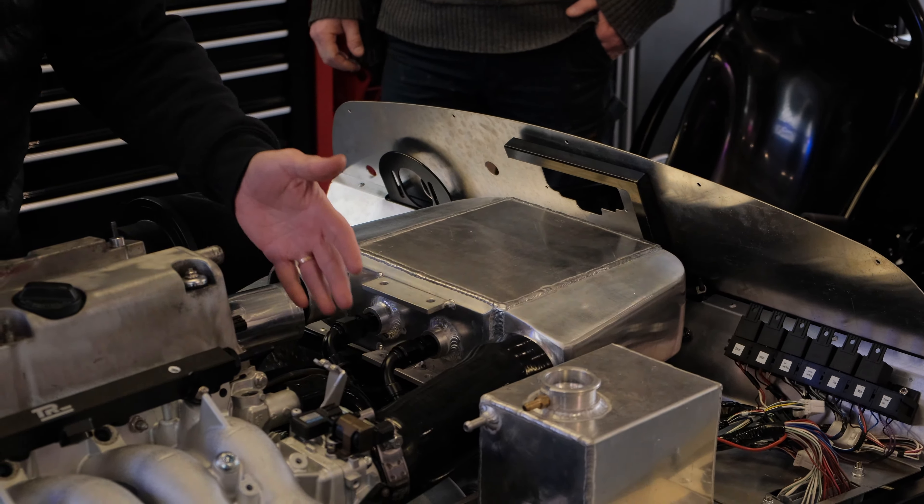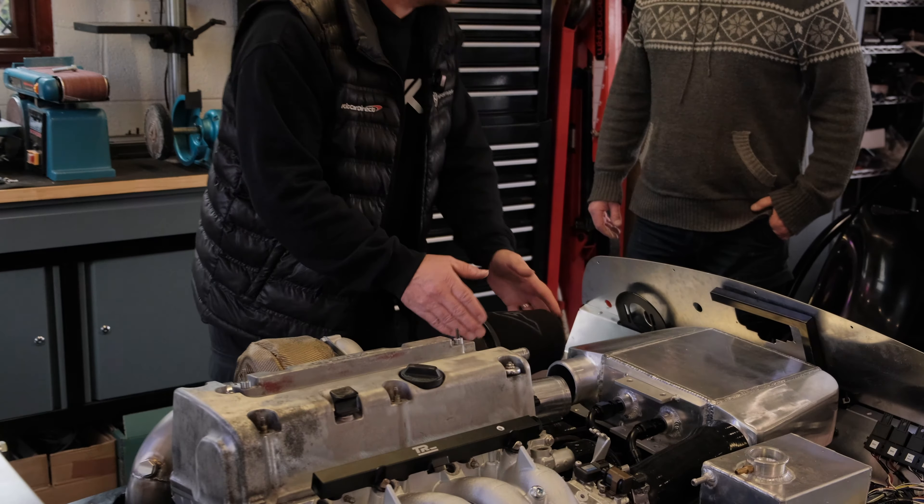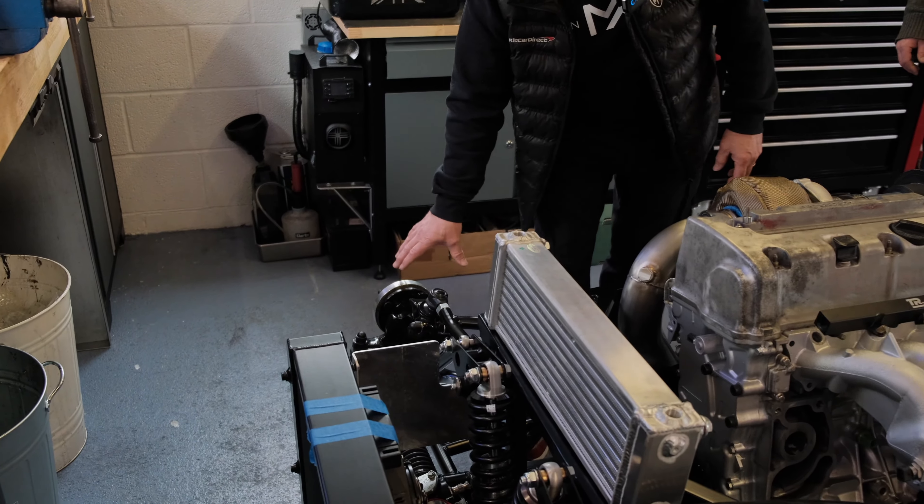Ben has been beavering away here and a lot's gone on. This is a Honda K20 engine, A2, mated to a BMW 330D gearbox, adapter plate, clutch, etc. - all on there. Pulsar turbo, I think it's a 3076 or something, big enough to do 400 horsepower. The link pipe was all done, all the exhaust system - really, really nice shape done. It's got a 38mm wastegate tucked under here, so we didn't do a screamer pipe - we built that in to keep the noise down because it's going to be road legal.